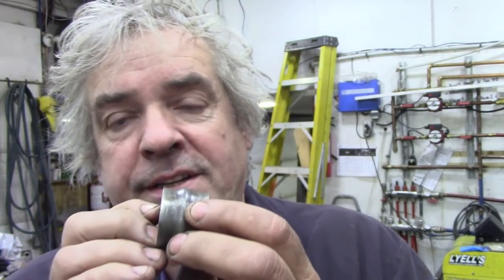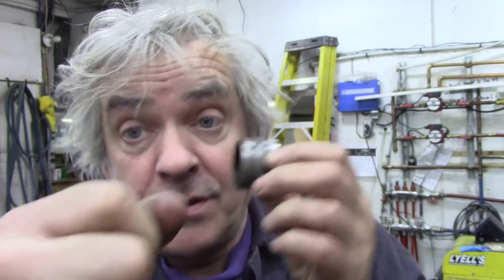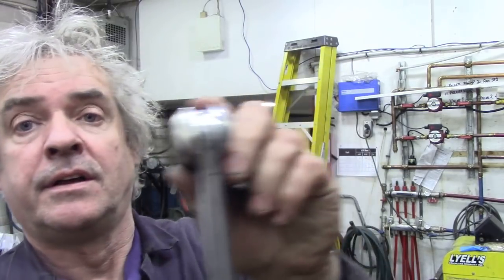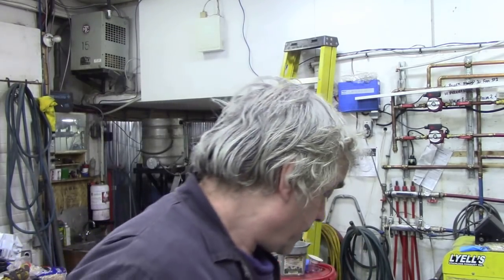because this little spacer, once you start to compress it, you just have to move your socket and bar ever so slightly. I mean, we're talking, you know, you're moving like this, stop, check, little bit more, stop and check, because the difficulty was the friction where the oil seal goes on here was kind of tight. So when you were using a spring balance off the holes, it didn't mean much at all.